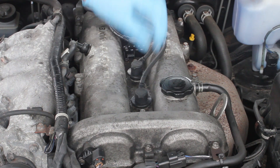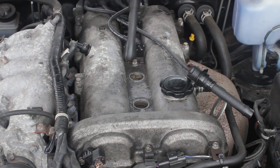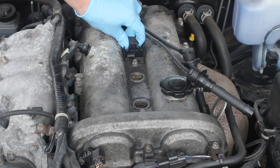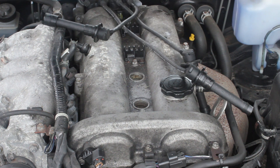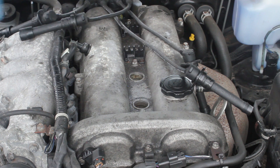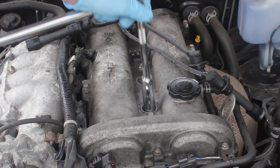When I went over to his we were able to crack them off using a small breaker bar. It made a big difference from the socket, because with the socket it felt like I was either about to rip the threads or the socket itself was about to slip as I took up the tension. So getting that out of the way, let's start again. Take your HT leads out and place them to the side in order.